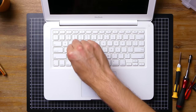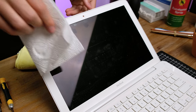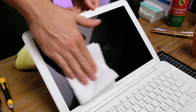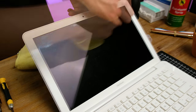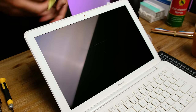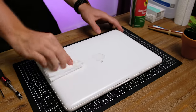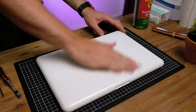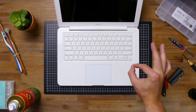Be sure to get in between the keycaps — I used a Q-tip doused in metho to do just that. To clean the display surface, I started with a paper towel dampened with water, then followed that up with some lens cleaning solution on a microfiber cloth. It ended up looking nearly spotless, aside from some marks left by contact with the keyboard. The marks on the lid came off effortlessly with a dab of eucalyptus oil, and the base also cleaned up really well. Since this MacBook is made of plastic it's not really going to dent, however this model is prone to scratches and cracks near the hinges — but luckily mine has no cracks on the body whatsoever.